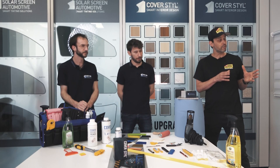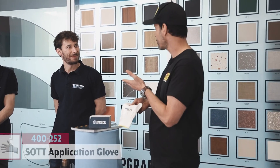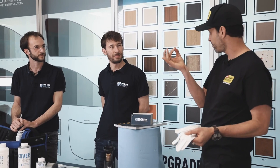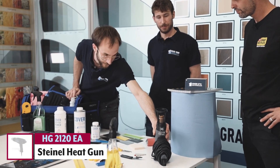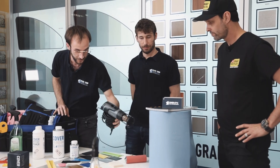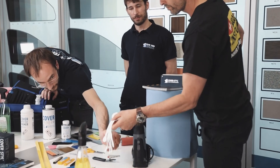What's unique about interior films is that you might think application gloves are just for car wrapping, but because the film is so thick, you really need to round the same edges and corners and get the material tight — otherwise it bridges up around there. Having a combination of application glove and heat is really important. We also have a cage for the heat gun, so when you place it on the floor you won't risk burning the floor. The cage helps you avoid ruining anything during installation.